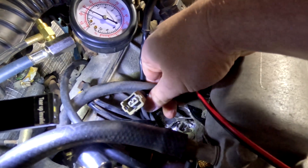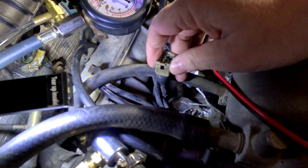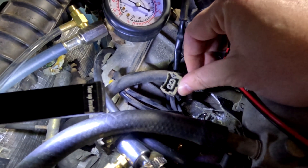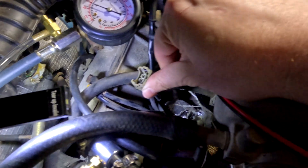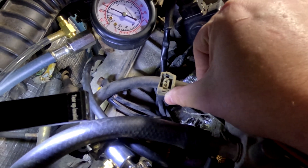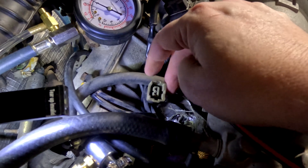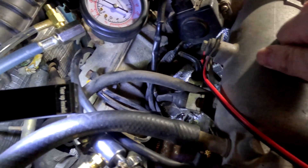If you're wondering how to get the injector connectors off: they have a little metal clip that goes around the outside of the connector, and that's what holds it onto the fuel injector. The best way is to pry that clip apart a little bit, then squeeze and yank up on the connector. These connectors tend to break a lot — I really recommend replacing them. I'll put a link in the description for the connectors I like. The replacement connectors have a nice little squeeze release that makes them much easier to remove.